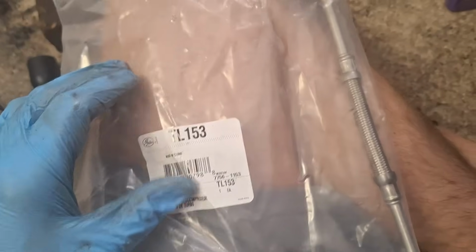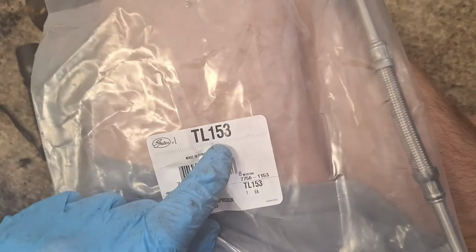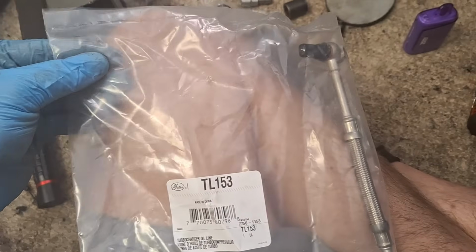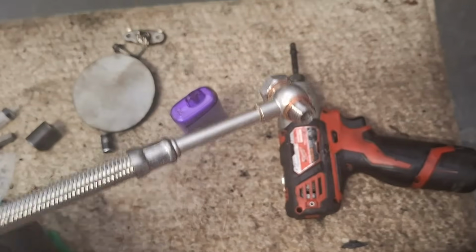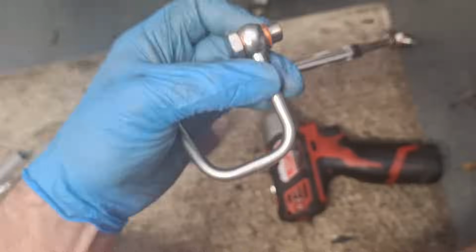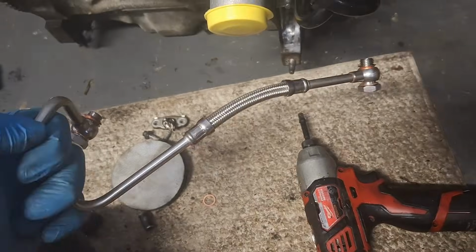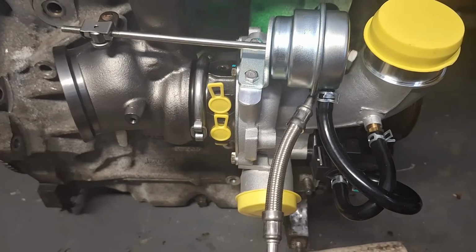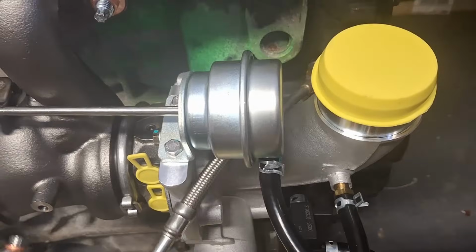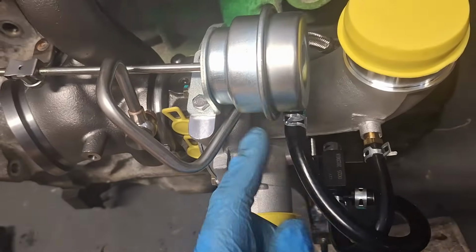All right, so next, the first thing I grabbed is the oil feed line for the turbo. There's a Gates part number, Rock Auto. It already comes with the new banjo bolts and crush washers on it too. Not a sponsor by anybody. All right, boys, it does appear that you'll have to bend this portion of the oil feed line a little bit, but it goes underneath this reservoir right here, like that. Here's where I'm at right now. I've got it routed underneath this thing here and coming down here.